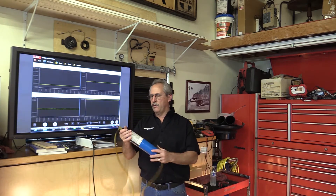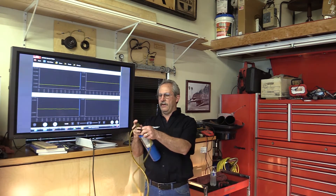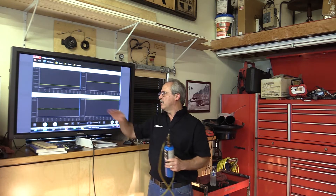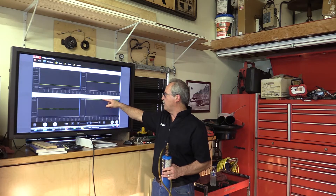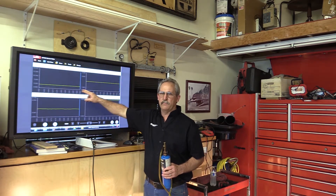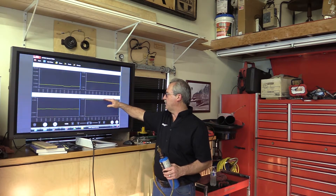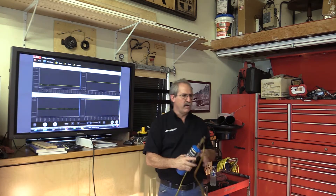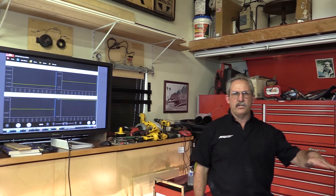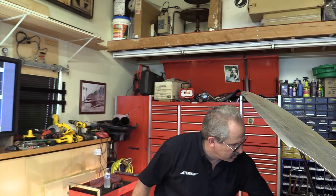I've got my propane rig here with a regulator and an on/off switch. I'll hold the button down and slowly crank the valve open to bring the AFR sensor voltage down rich and make my rear O2 sensor voltage high, while watching my fuel trims. When I take it away, I'll watch the front sensor go high and measure how long it takes for the rear sensor to go low — that's the amount of oxygen storage. I'm going to insert the propane hose into a spot on my air horn right after the mass air flow sensor, where the PCV vent hose connects.